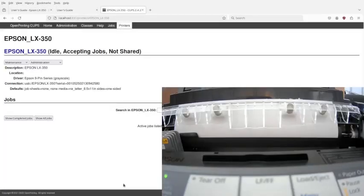The USB port works. The parallel port works. I assume the serial port will work very similar to the parallel port. It's just a matter of setting the settings. And then you could set it up with a modem directly and have it be a teleprinter. You can set it up serial to a modem to a radio and do it as a radio teleprinter. There's a lot of fun little things you can do with this because it has all these port options, all these setting options, right?